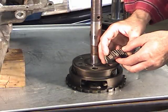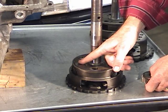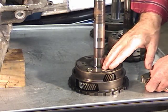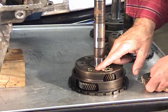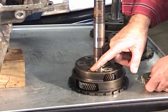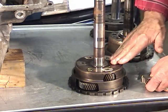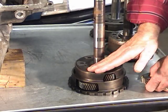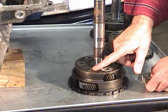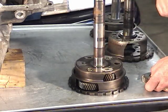The ring gear also has some damage. I've already ground down the tops of these gear pins, and I have one more to grind. You can use a cutoff wheel or a die grinder. The best thing, though, is to use an angle electric grinder that has an abrasive wheel on it. You want to take all of the stamping off. These are kind of riveted into place, so you want to grind those down flush with the back part of this output shaft hub. You're going to touch a little bit of that area and shine it up, but try to keep that to a minimum — just cut it down flush.